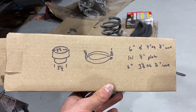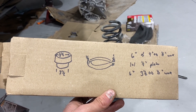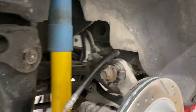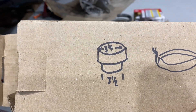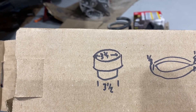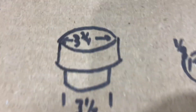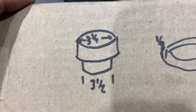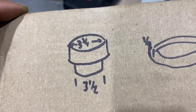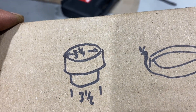For the spacer I've got my CAD here — my cardboard-aided design. I drew up what I'm going to make. The inside diameter of the spacer is four inches, the outside diameter is five and a half inches. The existing perch there is a three and a half inch diameter outside. So we drew up three and a half inches on the bottom, three and three-quarter on the top inside diameter, so it'll slide right over the existing perch. With a four-inch hole, we will put a flange here that will go out to five inches. I'll order a plate to fab that up. Between the two, we'll probably start with adding an inch or an inch and a half, set it on the ground and see how that looks, and we can trim some off if we need to.